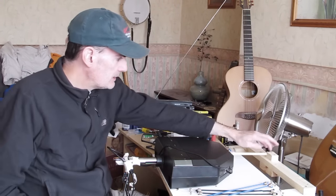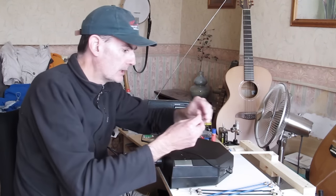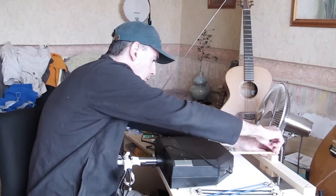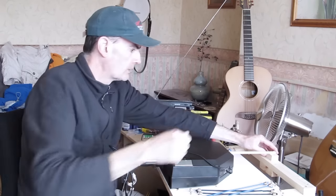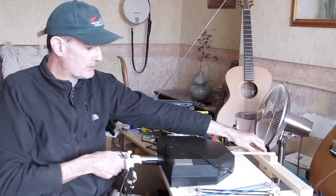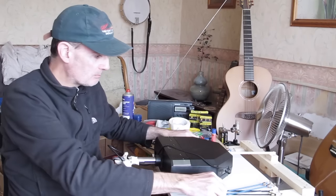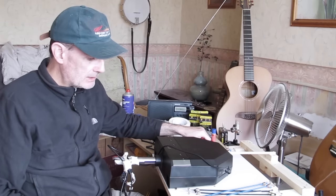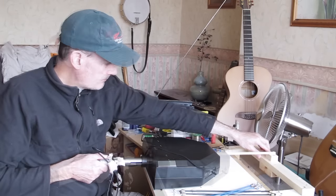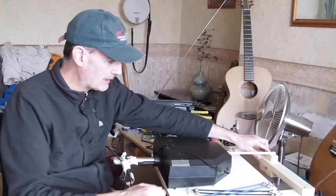The other thing that's different is the crank push rod, I think we'll call it, comes out of the back, and just using this screw is anchored at the rear of the frame. And so you can see as I push and pull, that operates the elevator action nice and smoothly. I'm getting some clicking noises from these bungees. The way this is set at the moment, at the extremes the opposing bungees go slack, and so you get some clicking. I don't really like that noise.